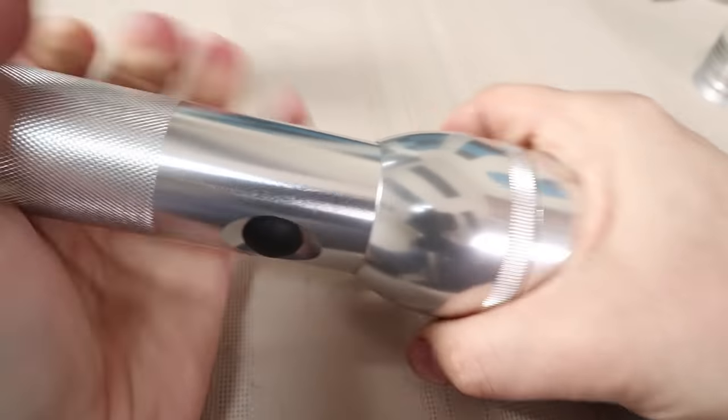Onto the Magcharger. This is the rechargeable mag that snaps into a cradle. Same thing, take the bezel off. The heads don't just come off of these, so unscrew the bezel and remove the lens, or, you know, take off the bezel and the old reflector out. I lost my reflector, but take that out. You don't need it anymore. This head will scoot down some.